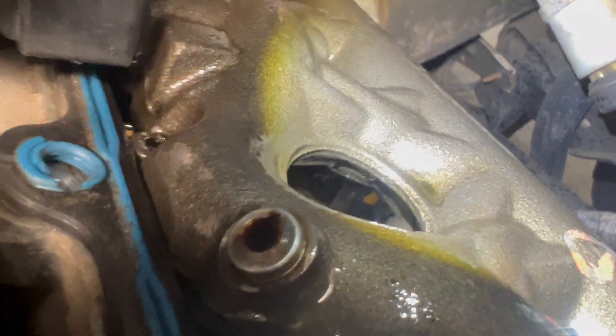That's what we're going to go after. I'm going to attempt to show you all this - it's hard to see. You can see it bubbling right there. I think it's the upper injector o-ring or it's the nipple cup - we're probably going to replace both just to cover our bases, but we'll know if it's here when we pull it apart.